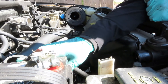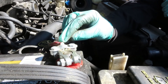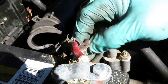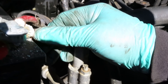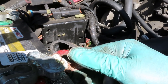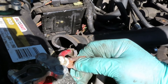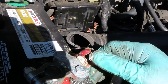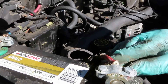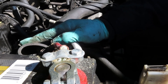The next thing we're going to do is put our hose on. You see all this corrosion right there, going down into the wires? That will cause your computer to short out right there guys. Because that corrosion gets down in those wires, it's going to cause so much resistance and it will short your computer out. Usually we got a video on just putting some hot water on it, but this is beyond that. This cable is going to have to be replaced. I gotta let them know about that.